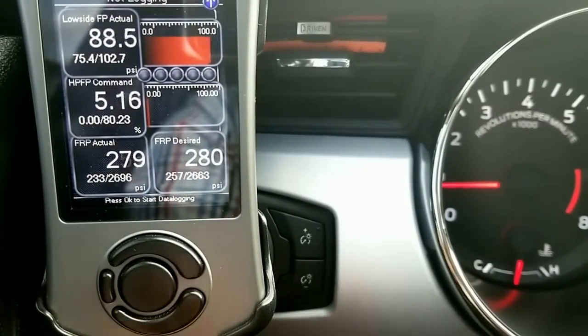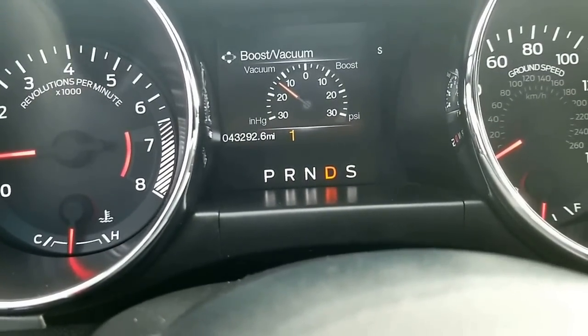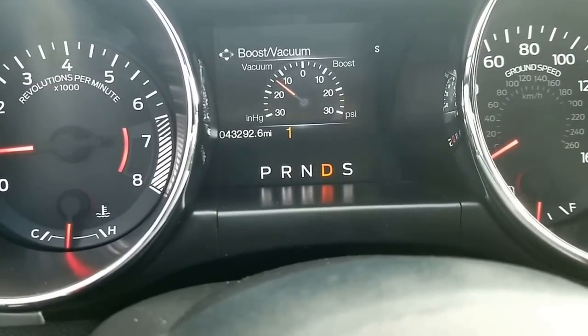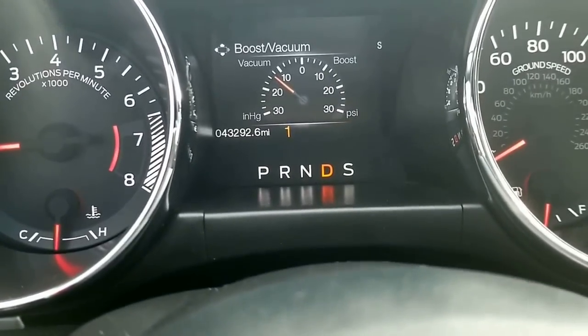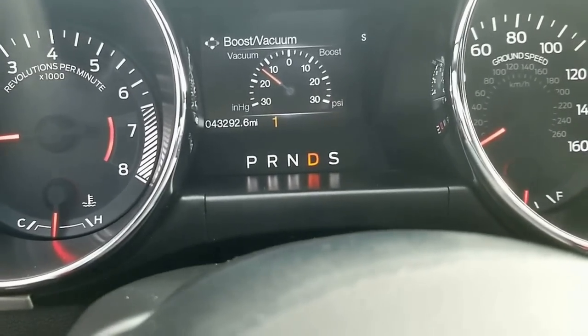So that's basically it, guys. Do this on a safe road. You're going to be in low boost, so it should be safe, but play it safe. Right now I'm in traffic so I wasn't able to show you exactly, but you get the idea — just go into boost at 5 or 10 PSIs and do the monitoring per gauge.